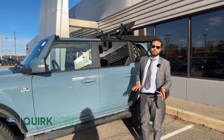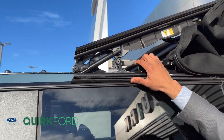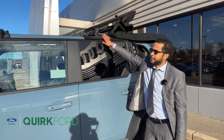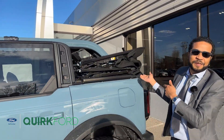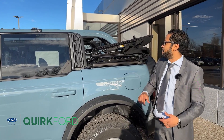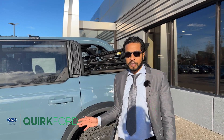Once you have all the panels removed, there's a latch located right here with the arrows pointing down at the top of the convertible. Just release that latch and your whole top will fold to the back. This is actually a safe method to travel with — this lever here will lock it into position. To go further, you'll need to use your Bronco Toolkit, which I'll show you shortly, and which we'll also use to remove the doors.